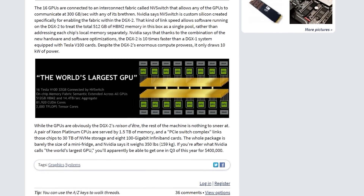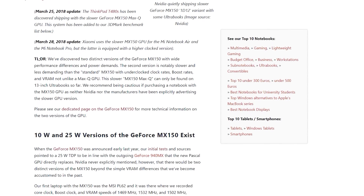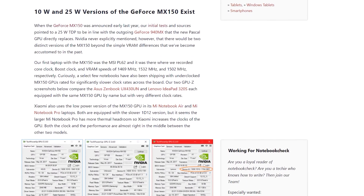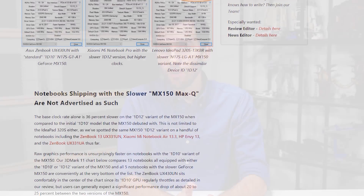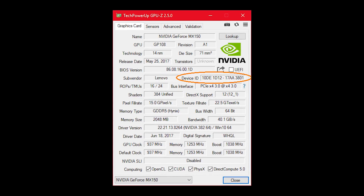So I know a lot of you guys out there will be rushing out to purchase one of those. Notebook Check discovered NVIDIA has quietly launched a slower variant of their MX150 discrete GPU designed for 13-inch notebooks. The 1D10 variant is the standard model we've been seeing in larger laptops, while the 1D12 variant has a more strict power limit so it can fit into smaller thin-and-light systems. While there are no published TDPs, the 1D10 is approximately 25 watts while the 1D12 is more like 10 watts. This power limit reduces clock speeds — down from 1532 MHz GPU boost and 1502 MHz memory to just 1038 MHz boost and 1253 MHz memory — causing a 20 to 25 percent performance hit relative to the full MX150.